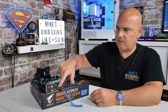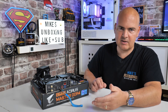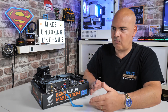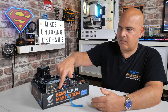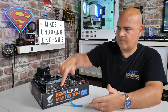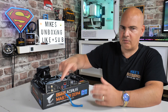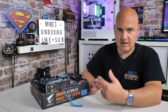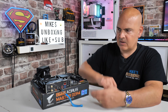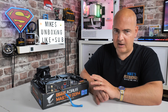The light is still flashing, so we're going to let it carry on. Set a timer for about five or six minutes — if it goes over seven or eight minutes something has gone wrong. Some BIOS flashes are actually really quick. The fan on the power supply just kicked in, and now the speed has changed — it's gone from the reading and initializing state to the actual flashing state, so we've got a slightly slower flashing LED. After that it may go fast again and then turn off. We'll come back when it's finished.